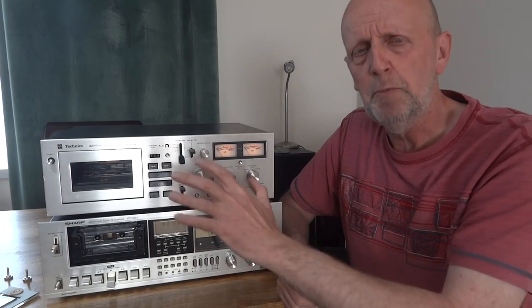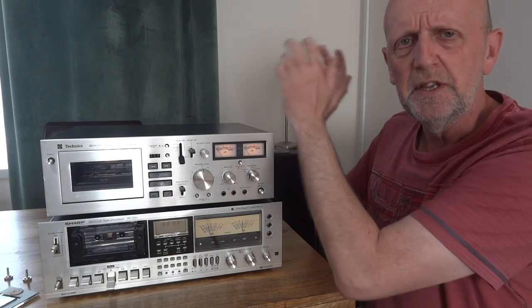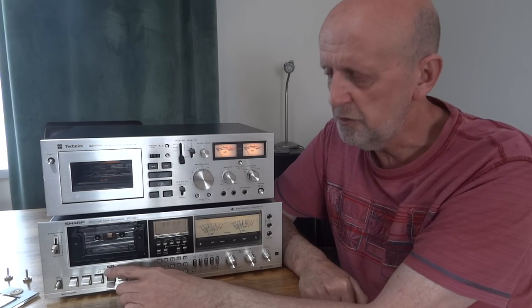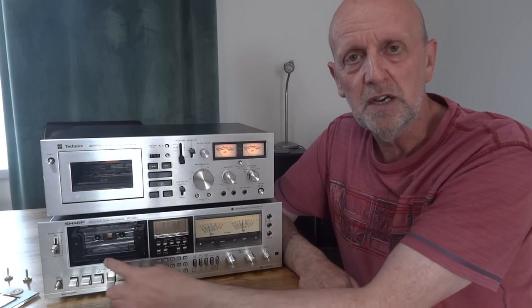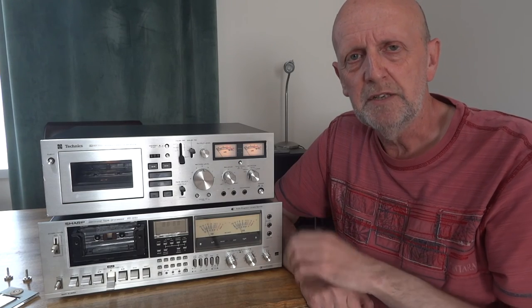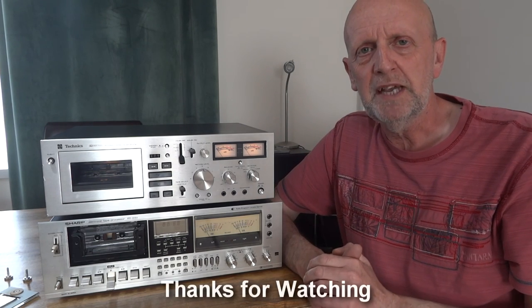If you don't do that and put it all back together, you've got a nice bright sound but you come to listen to something and think it doesn't sound as it should — the instrument placement and vocals are slightly over to one side, and sometimes it can be really far over to one side. So that's it really — it's usually fairly straightforward. The manufacturer gives you a way of getting into that azimuth screw. Hopefully you don't go too far. Just take your time, don't shear that screw because once you shear it, it'll be a big problem. That's a very quick, cheap and easy way of adjusting the azimuth of your tape deck.